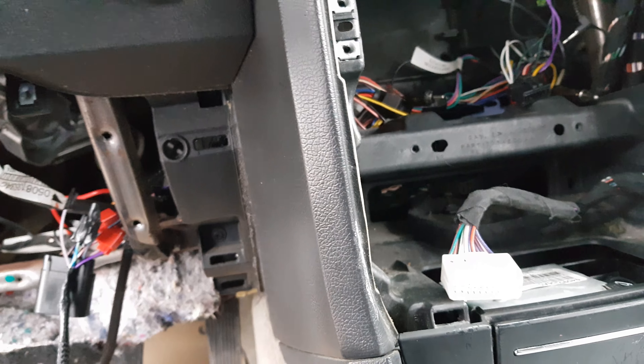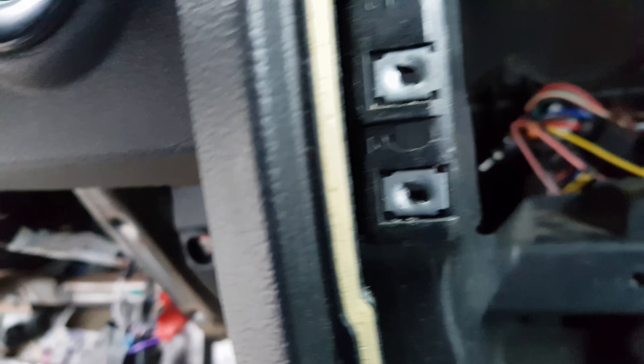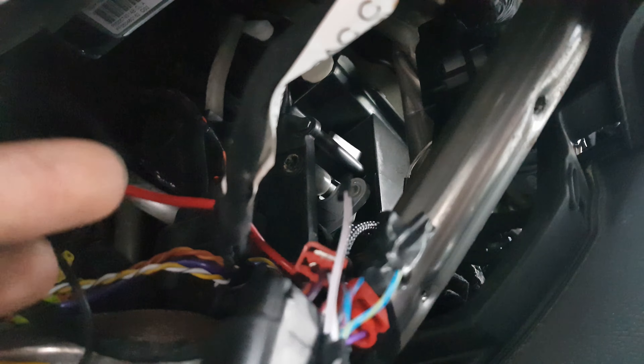It's plug-and-play — well, it's really not plug-and-play, but it's not that hard. When you come back here you'll see the OEM connector that comes with the vehicle. You want to take that out and plug it into the one that the remote start module comes with, and then plug the other end in here.